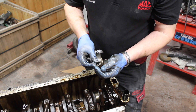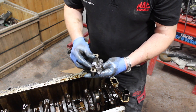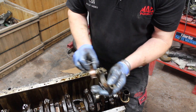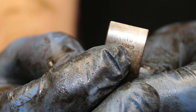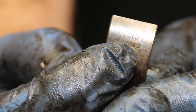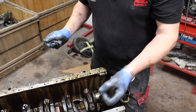Although this engine did seem very clean at first glances, they can be deceiving — the bearing caps are showing that they are shot. So it was correct to pull it apart. The markings do show that she is still running standard bearings, so she is still well within tolerance to be able to be machined.